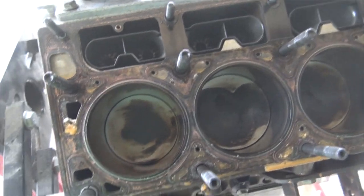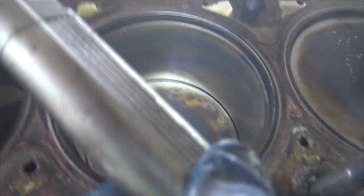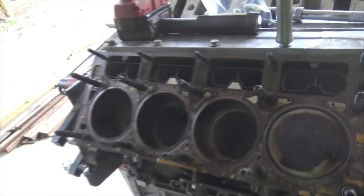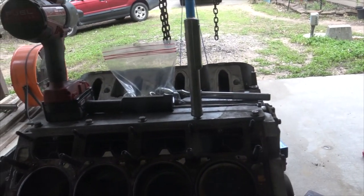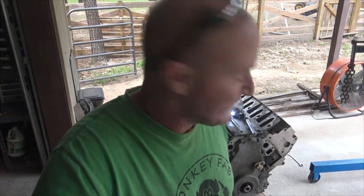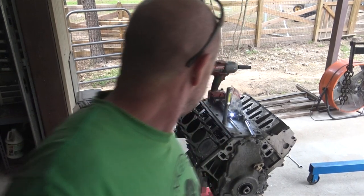So this was the one that was kind of goopy looking, but actually they pretty much look the same. I don't see scarring, but they look really shiny with almost no crosshatch - which you usually see crosshatching. Maybe my own fault for running too rich, kind of washing it out, or not changing the oil. Whatever it is, I guarantee it's my fault. At least we can salvage some of the good bits on this engine.